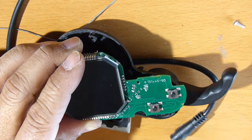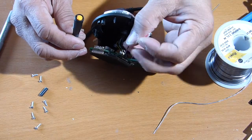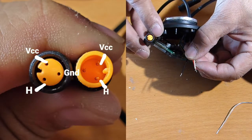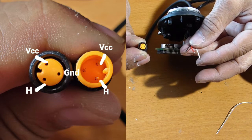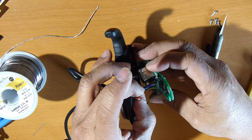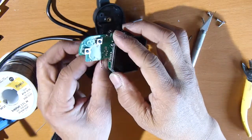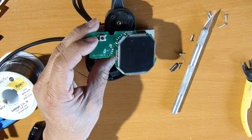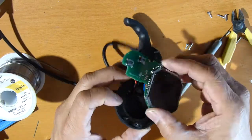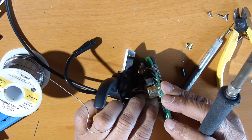VCC is going to be on this side, and then the Hall Effect sensor here. The center will be ground. From the previous mapping, we know that black is ground — black wire here, which is the center. The Hall Effect H is red, and the VCC is white. Plug this in here — the center is ground, insert it right into the center. Okay, insert the white right here, now insert the red wire through. Okay, now that we've completed the center, solder.